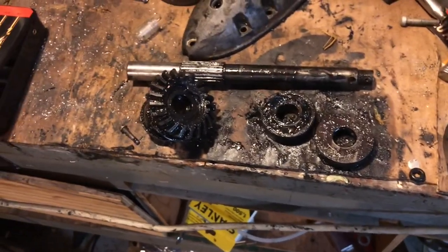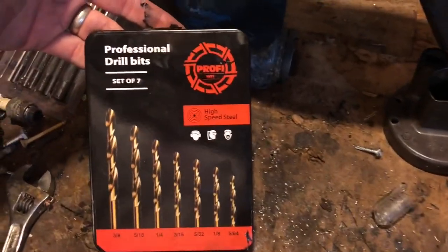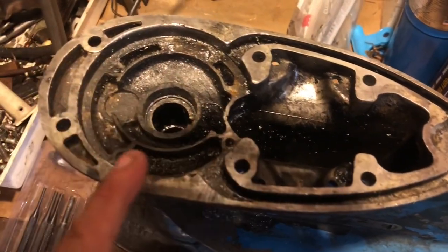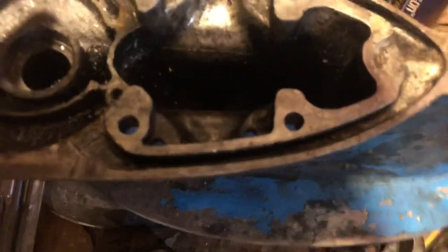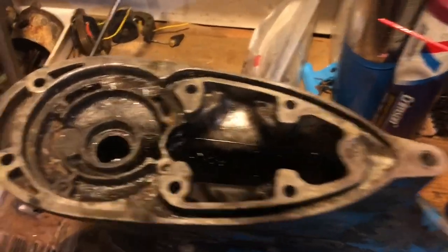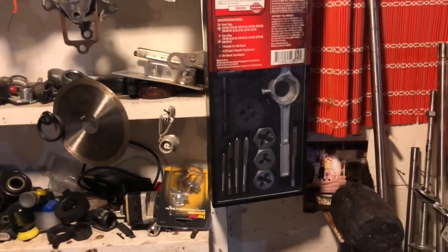Again, the 30 horsepower — not that it's difficult, but I'm learning as I go. If I can make a suggestion on drill bits — everybody goes to Home Depot and gets the standard oxidized drill bits, and every time you try to drill metal they snap. I went on Amazon and picked up these — I don't know the brand but they say 'professional' and weren't too expensive. I've been drilling through metal three or four different times and not one broke. These drill through metal fairly easily since it's aluminum. I'd recommend these or definitely the reverse left-handed drill bits — worst case if the bolt won't come out, you'll get a nice hole and have something to work with.